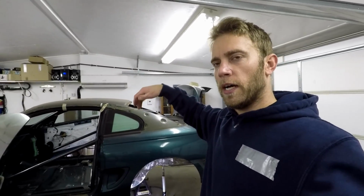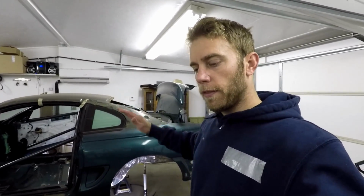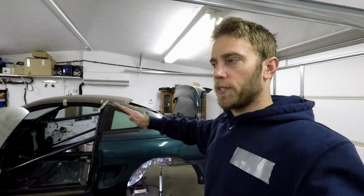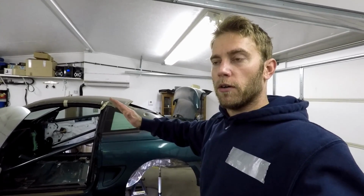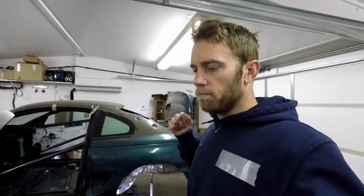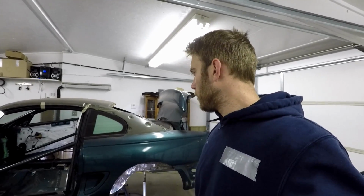Because if you remember, I said in a video before, if your torque boxes aren't aligned, then it changes the arc length of your control arms. If you know about bump steer, it's kind of similar. The way it moves, it might be the same length here, but once you're into a different point of suspension where it's down here, it could be longer or shorter, and it could actually steer the car. So it's a critical point you need to pay attention to, and you can use those methods I showed you. It's not hard to do.